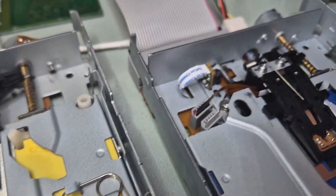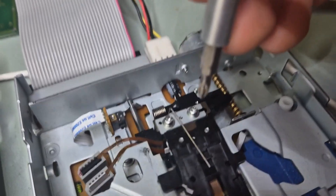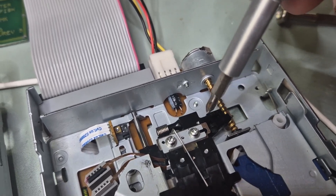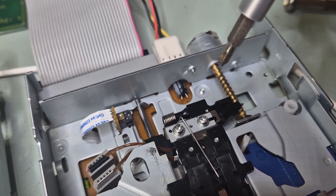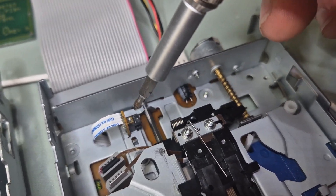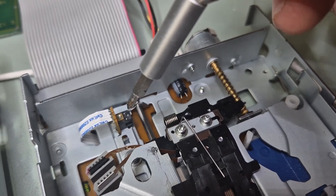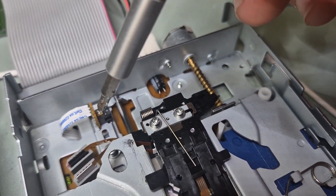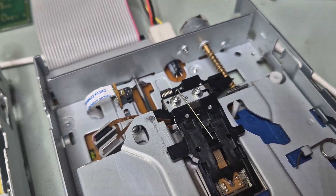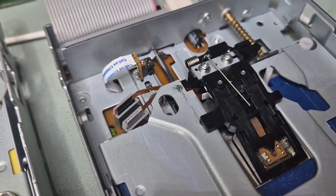I did have to tinker with the alignment slightly, and this is not something I wish on my worst enemy, to be honest. It does require just fine-tuning, so avoid touching this if you can. The idea for aligning is that you slightly loosen these two screws here, and underneath, you see that little shiny bit of metal? You need to very, very minutely micro-adjust that — it goes sideways and up and back. Sometimes when this guy gets dislodged, the motor is a bit too strong and it can push this. So you need to just either push it back or forward slightly. Normally you just realign the head slightly by moving this plate underneath. It's micro-adjustment, and you need to both align the lower and upper heads for it to work.